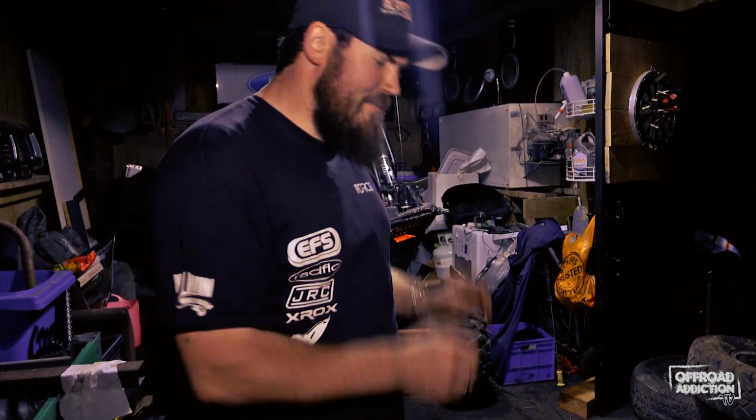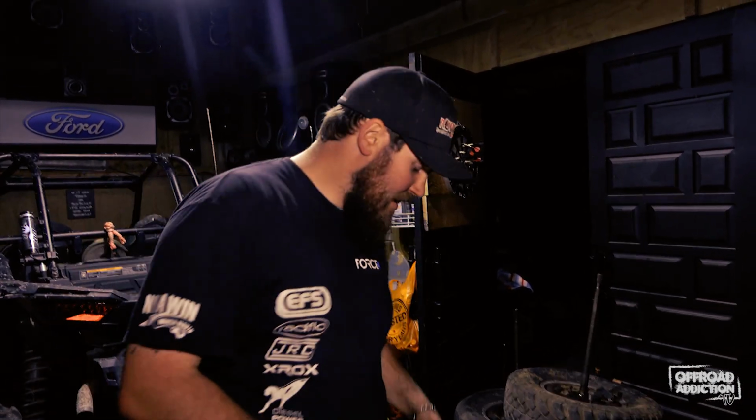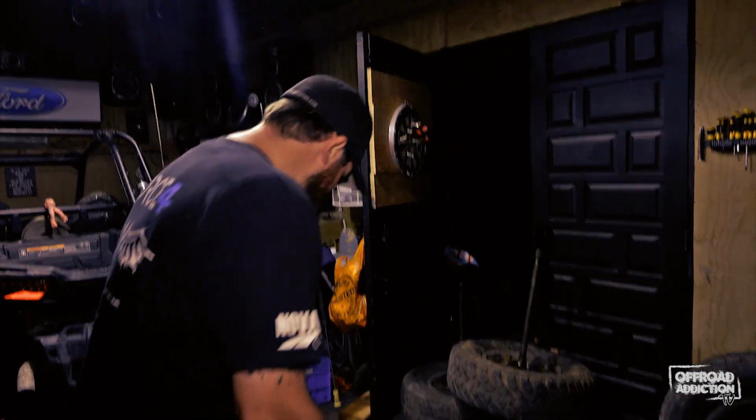Now I was very stoked when I pulled the head out of this front axle housing. It came with 4.88 gears. Absolutely stoked with that, because what that means is it's going to help me turn my 35-inch Simex tyres that are going on it. Anyways, I haven't actually pulled this one out yet, so anything's possible. We're hoping for a matching set of 488s, but if not, we're going to have some dramas, and I'm not sure how I'm going to feel about that really. Anyways, we'll get this one over here.